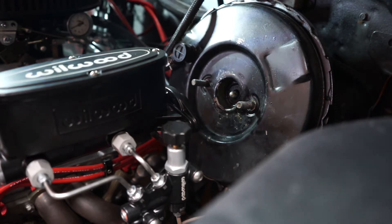The Wilwood website has nothing about adjusting that pin — I really didn't see it mentioned in too many places. I'd seen one of these tools before, but I figured I never had to adjust the booster pin on the master cylinder. I've heard about boosters where it's non-adjustable and you have to grind it down.